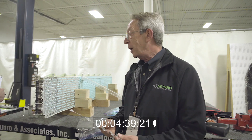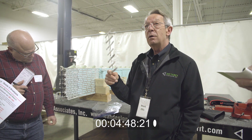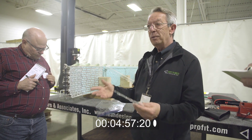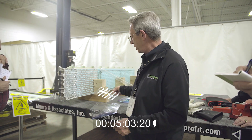This is one of the four modules within the whole battery pack. There's 350 volts total. The total number of cells is what gives you the premium battery pack option. This is the premium battery pack. The optional one has three fewer groups of 46 cells in each of the modules compared to the bigger one. There are still four big chunks, just smaller.